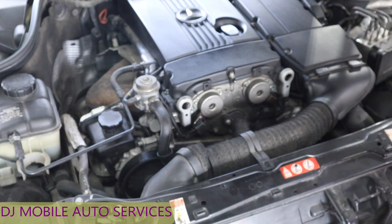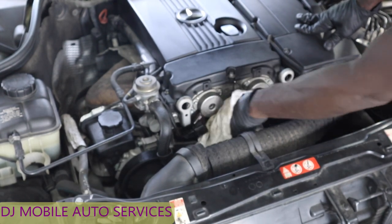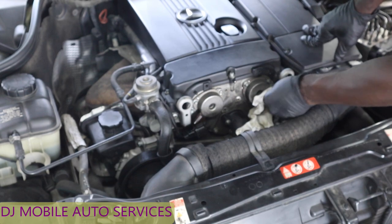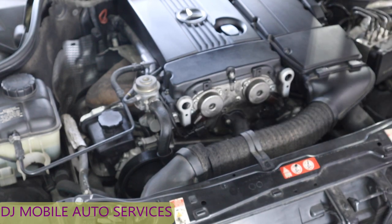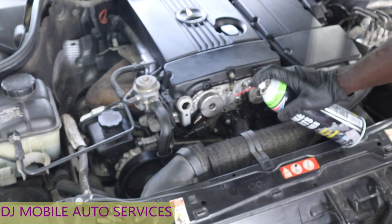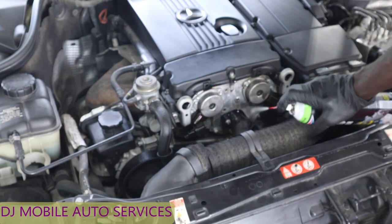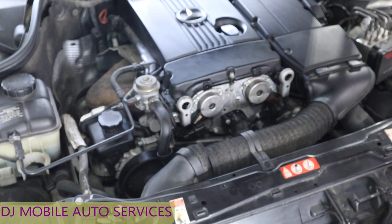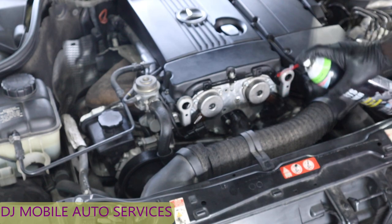See all the oil on my hand — there's an O-ring behind here that leaks, and it also leaks at this grommet. So next I'm going to clean up in front here. You can use some brake cleaner or a rag to clean up whatever oil residue is on there. Try not to damage it, because then you'd have to purchase another magnet and they aren't cheap. You can use a degreaser as well — I've got cardboard on the vehicle so whatever drops lands on that.